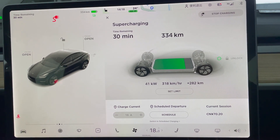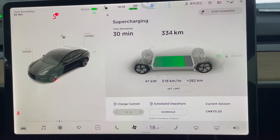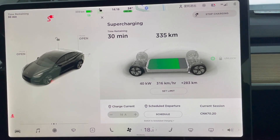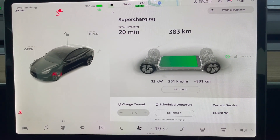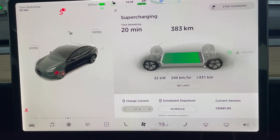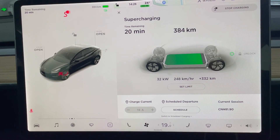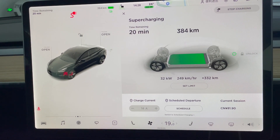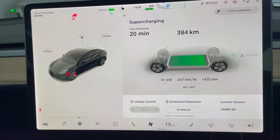Let's see what happens when the charging speed reaches 90% state of charge. The state of charge has reached 90%. The charging speed has decreased to 32 kilowatts — frankly, that's quite slow. Time remaining from 90% is 20 minutes. For daily usage, if you are in a hurry, you can charge only from 5% to 75%, which only takes about 30 minutes.